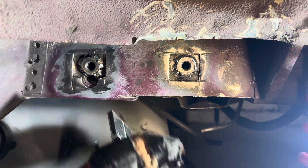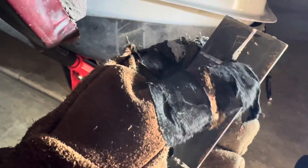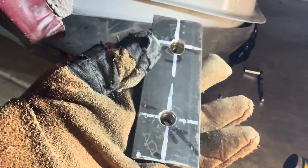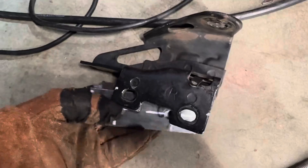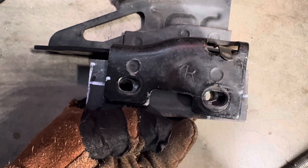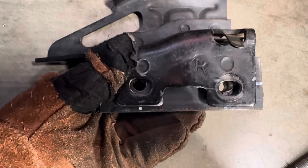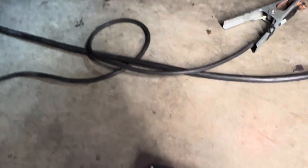The material used here is a lot thinner than this, so it'll be even better. When you're welding these on, make sure you tighten them down — put the bolt through there and put the nut on there and tighten it down. I made this hole a little more of an oval to give it space so it'll go like this. It'll have enough room to kind of slide back and forth if you need to. Put it in position and everything will line up perfectly fine.